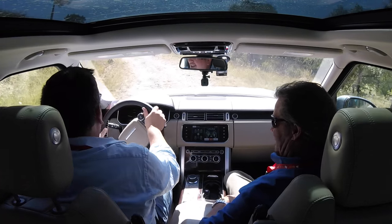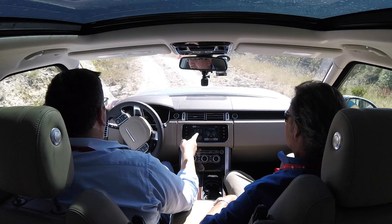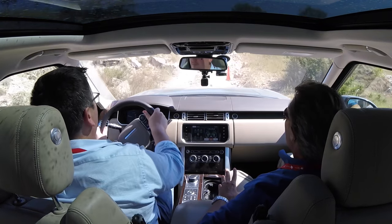Yes. Okay. Now, one thing is that the air suspension is also keeping the vehicle level at all times, right? And so, in addition to the ride quality and the height, it's working with its own articulation, which we're seeing here on the screen. Okay. So what we have is called a cross-link valve in these cars. And so, when this car is articulating through the rocks or those moguls or articulation holes, this valve opens up and it feeds all the other air into the other wheel. So it's always trying to get traction. So even though it's an independent suspension car, it acts as a solid axle. So it's articulating, always trying to find traction with each wheel.